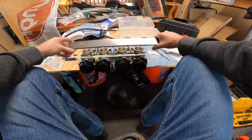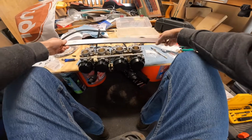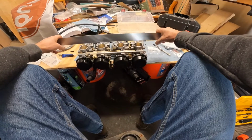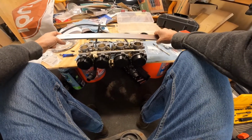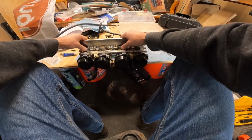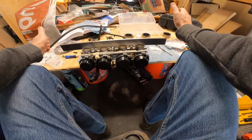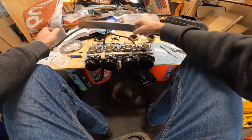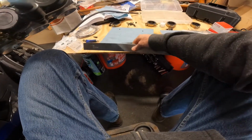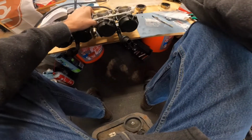Alright, I'm back. I bought this straight edge. It's a machinist straight edge, and it's straight within 0.5 thousandths across the entire length, and that's very straight. I bought this to check engine blocks and cylinder heads for flatness, but it can be used here as well, although I'm not sure that this is a good setup, because what I really want is a nice flat surface for it to rest on. Of course, I can use it to tell how not flat my board is. Anyhow.